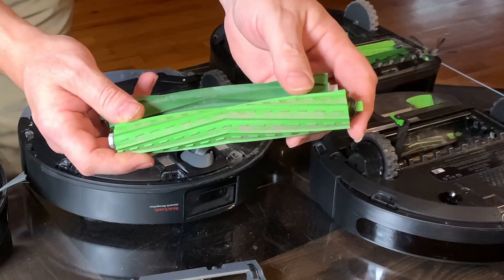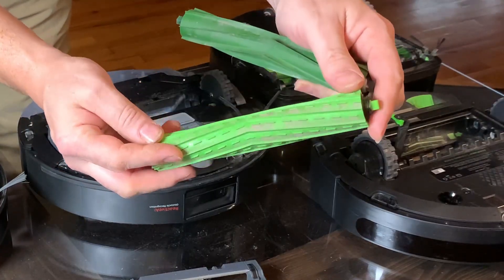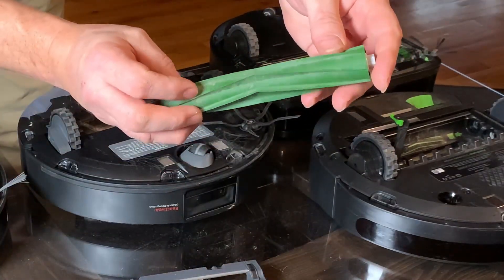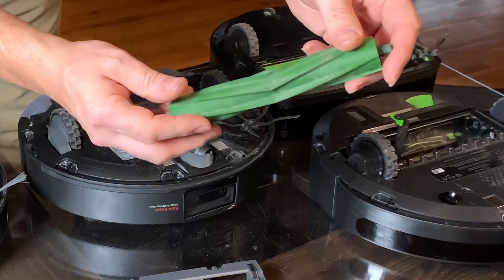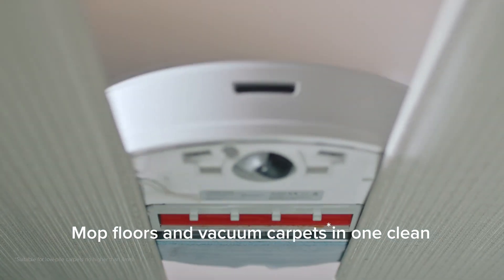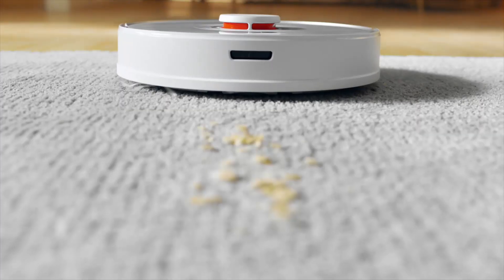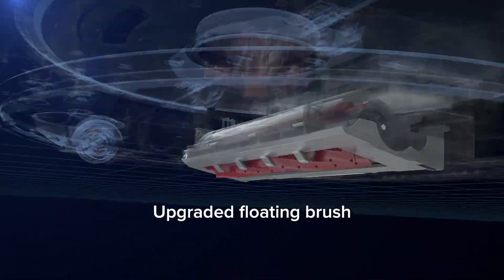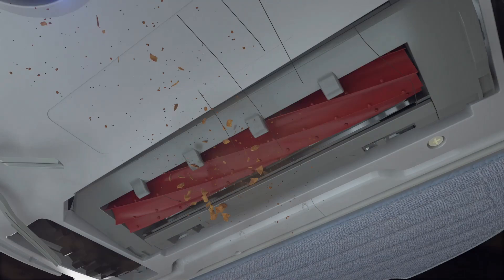The reason I made this video is that I recently discovered that my Roomba i7 and S9 were scratching my floors. The problem was twofold. The first was that these rubber-like brushes pick up dirt, which stays embedded in the brush. If that dirt comes in contact with the floor — which it does because of the floating brush design — that dirt is going to scratch your floor. This is where the Roborock's new brush design becomes potentially problematic, though they could have taken steps to remove or completely eliminate the scratching.